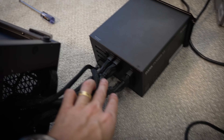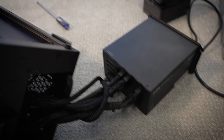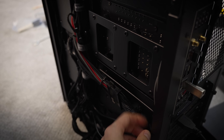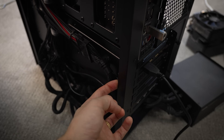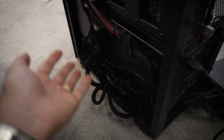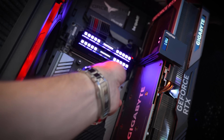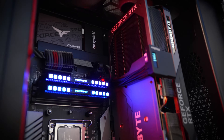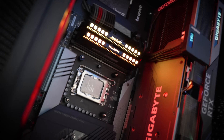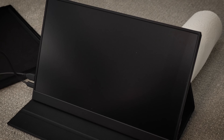All of the primary connections are sound. I've got a chip in there with no cooler — don't worry, it doesn't get hot. I'm feeling it as we speak. Not getting hot. There is a debug LED for CPU lit up, which is interesting. I've also got a screen hooked up just in case, but we never get a post.